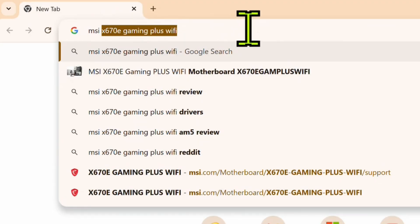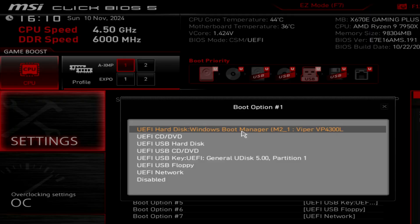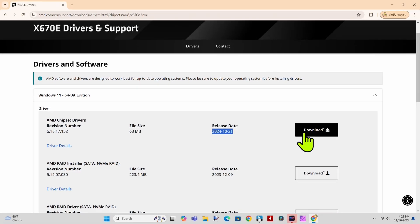In this video I've shown you how to update your BIOS. On top of that, I've shown you how to find out what motherboard you're using, how to find the support site for your motherboard, how to find your BIOS and tell what version you're on, and then everything in between to see all the updates and features it provides. Next, we flashed your BIOS, then optimized your BIOS defaults, and set some basics within the BIOS. Then we downloaded and installed the latest chipset driver, all to get you all the performance you need out of your system and get rid of any potential blue screens. This is Iggy with This Bytes For You, showing you how to flash your BIOS. Out — see you guys.